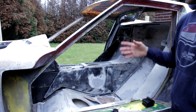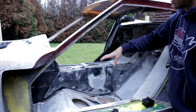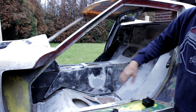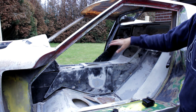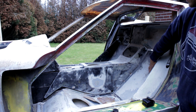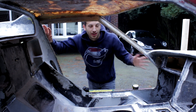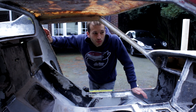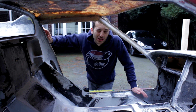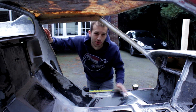Because this is a Series 1 Europa, we have the chassis completely encapsulated in the body shell, so we have to drill some holes into the body just to get to the chassis. Also, because the seat backs are the actual bulkhead, it's very difficult to get a roll cage there. I'll try to explain how I came up with the design — we're using the FIA rules, Appendix K and Appendix J for historic racing, just to get the design right.